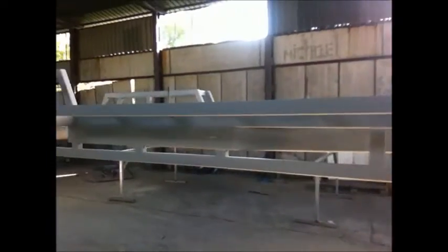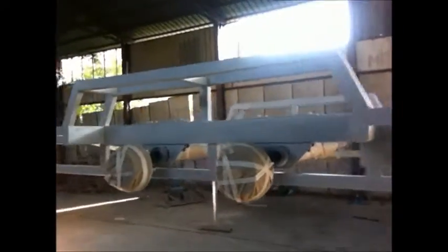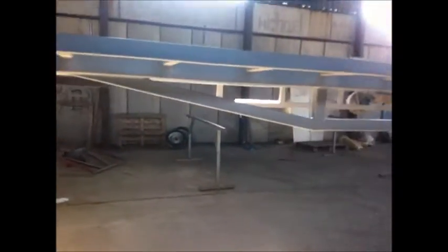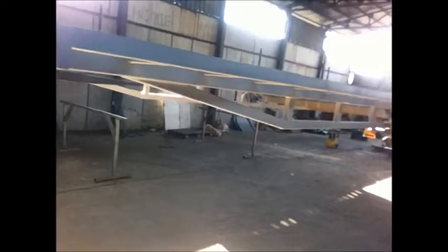Another few hours passed. All my epoxy primer is on. She is 100% primed, all covered. I'm still well within my flash time, so I've got plenty of time. I'm going to give it probably 20 minutes while I'm mixing — just have a little relax. Drink a beer even. Woohoo. Imagine.